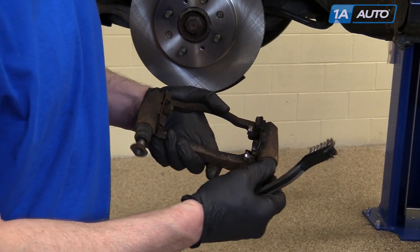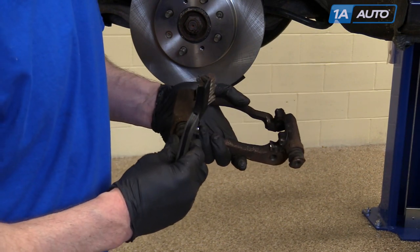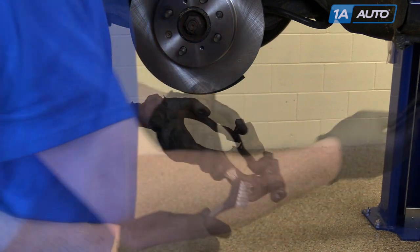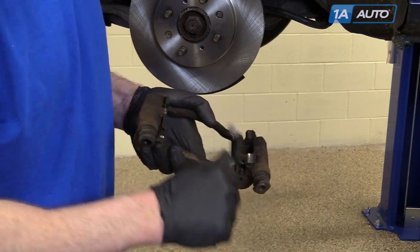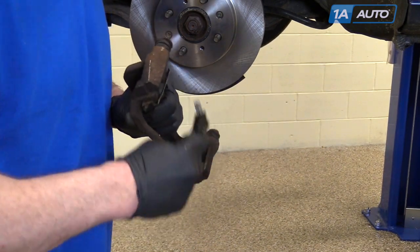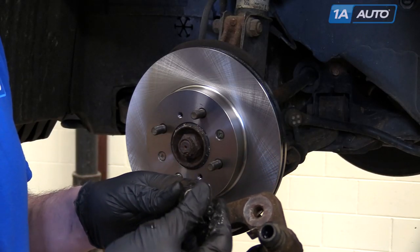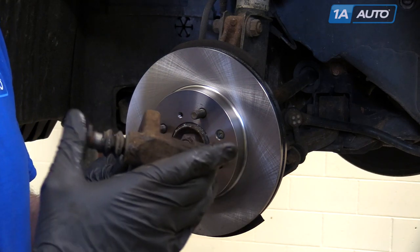Make sure that your slides here are nice and free. This one is a little bit less free than I'd like, so you can just pull them out. We'll clean it up and put some new grease on it. You'll also want to clean up your slides — if you don't put new slides on them, just use a wire brush on both sides. Then spread grease on and reinstall, making sure it's really free.